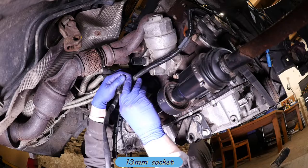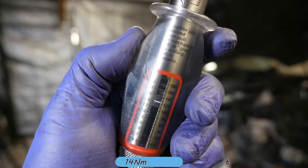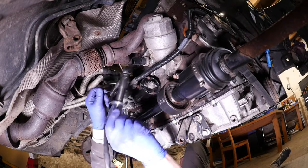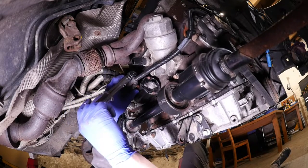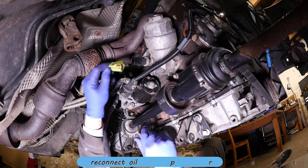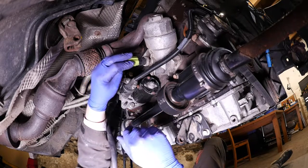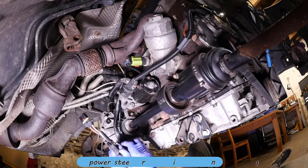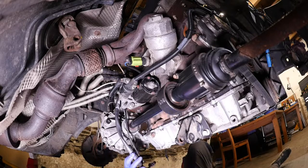This is a 13 millimeter socket to tighten this one up — those are tightened to 14 Newton meters, so not very tight. It can be useful to have one of these small torque wrenches — I put links in the description below the videos if anyone needs to buy any of these tools. Then we just pop on the connector for the oil pressure — there's a little locking catch, so pop that in. Those are the two wires that still need to go to the power steering motor, which happens when we get the subframe back on.